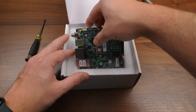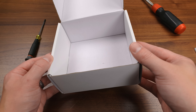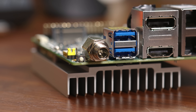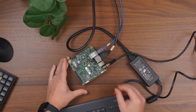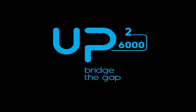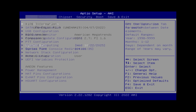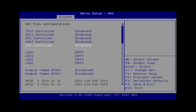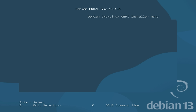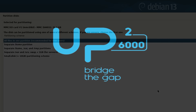Similarly to the missing SATA adapter, this also doesn't include a power adapter in the box — literally the only thing in the box is the board. So you'll need to bring your own 12V power supply. Fortunately it uses a very standard 5.5 by 2.5mm DC barrel jack. After getting it powered on, I was initially a little scared by a BIOS password, but just hitting Enter worked. The BIOS was pretty simple with lots of GPIO configuration options. I started off by installing Debian 13 straight to the eMMC storage, which worked just fine.